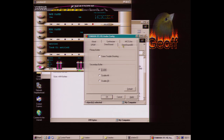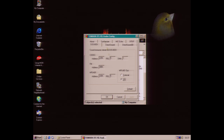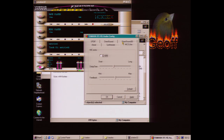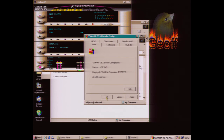The software is going to install a control panel applet which allows you to tamper with the card's parameters a little bit. Just turn everything on on this tab — don't know why they're off by default on mine. Then look at the DOS box page — there's a strange MIDI option there: external or XG. We already know XG is Yamaha's extension to general MIDI, so what would that do? We'll find out soon. It's worth noting that despite the fact it has its own applet, everything is done through the standard Windows interface as well. Resources and which synth you use in Windows can all be set through multimedia and device manager as per usual. I hate cards that lock this stuff down, so Yamaha's done a good job here.